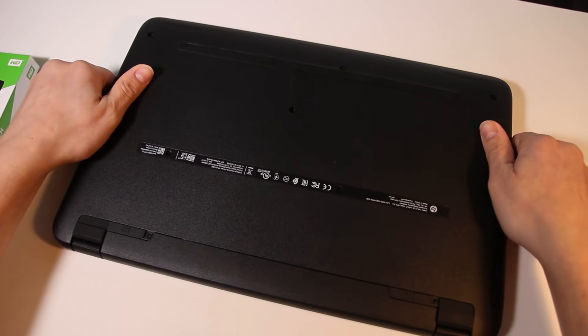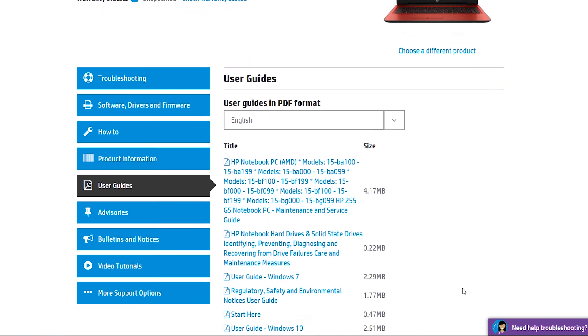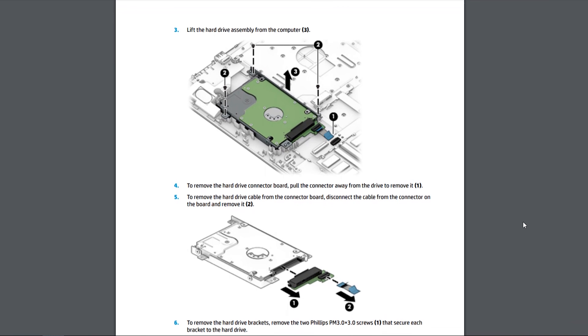On some laptops it's really easy to remove the hard drive — you turn it upside down, unscrew a panel, and the hard drive is just inside. Unfortunately this is not one of those computers, and I think it's going to be one where I need to remove every screw and pull the whole thing apart. The best thing you can do before starting is go to the manufacturer's website and check for a service manual for your model. The service manual gives you step-by-step instructions showing which screws to remove and what screwdrivers you'll need. If it seems too difficult, you might be better off taking the computer to a local expert. And if it's still in its warranty period, take it back where you bought it.